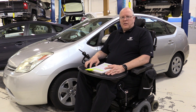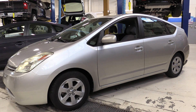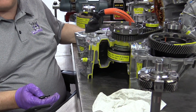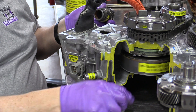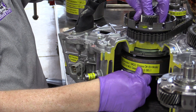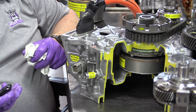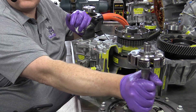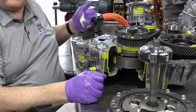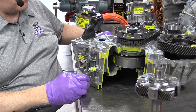So let's go take a look at the major changes and differences in the P112 transaxle. If you recall from the P111 transaxle video, the MG1 rotor turns the power split device sun gear — one of the three parts of our planetary gear set. We've got a sun gear, a planet carrier that turns the same speed as the engine, and then MG2 that drives the ring gear — when it moves, it makes the tires move.